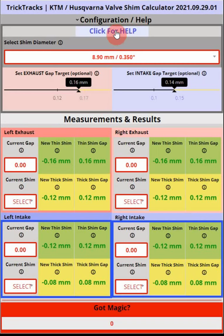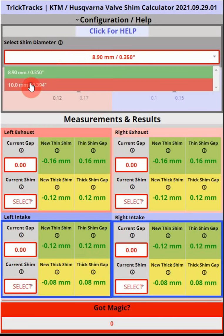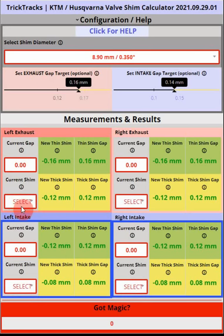If you click this button here it will take you to the online help. The first thing you need to configure is the shim diameter, which is available in the help section — you can see what shim diameter your machine has. You pull this down and select either 10 or 8.9. That's very important because it populates the shim pull-downs and affects the calculations.